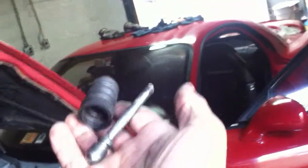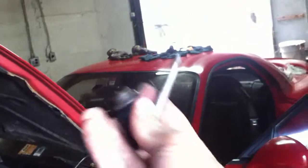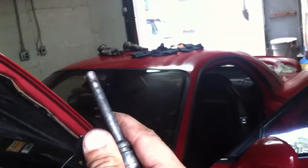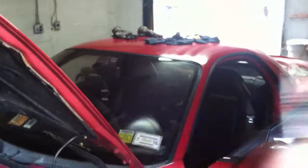This right here was on my cylinder. I removed this — you don't need this. You don't need the boot and you don't need this oversized push rod. Don't freak out, just remove it. You just got to wiggle it and it'll come right off.